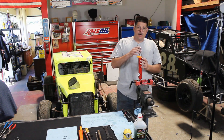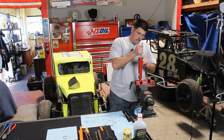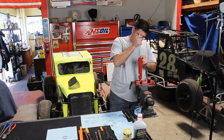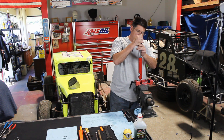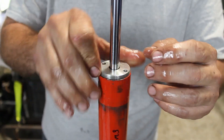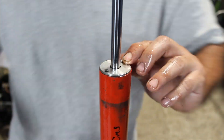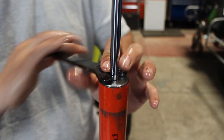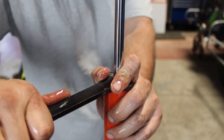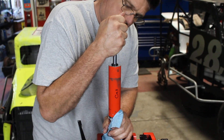We've waited five minutes and now we're going to go ahead and check our shock and make sure everything is good. I reach in and put my finger on the compression tube, go ahead and run the shock through its stroke. Everything looks good. I'll pull the gland down, push the gland in place. New O-ring seal — push my O-ring down in place. Close your nut, careful not to cross-thread that. You want to bring these down pretty snug — good and tight. Run through your stroke to make sure you don't have any air in the shock.